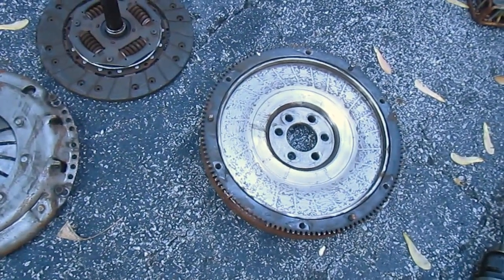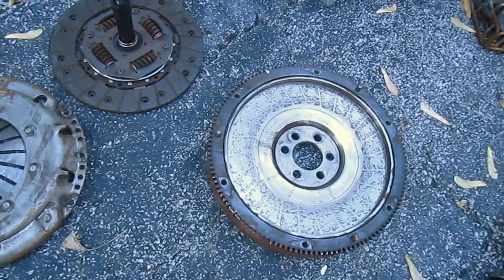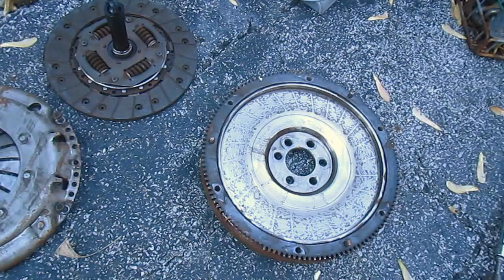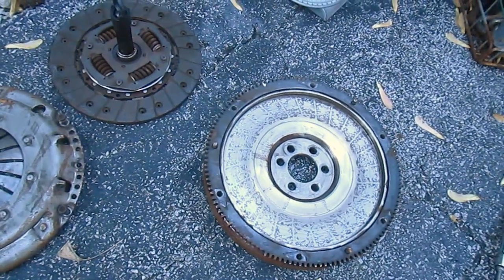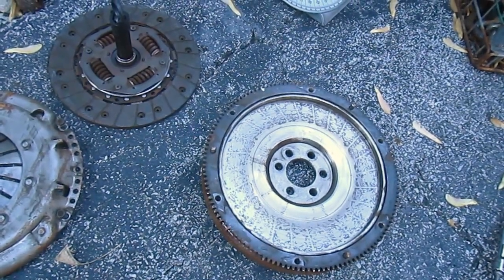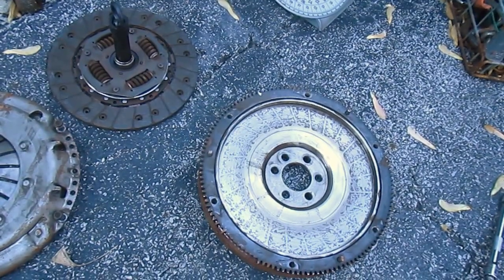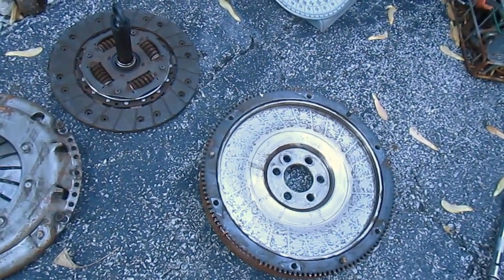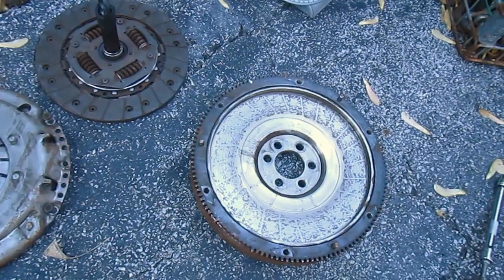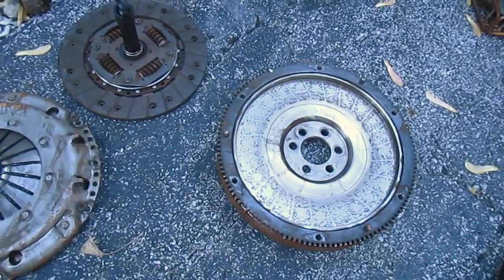That's it — just want to give you guys an update. I'd let you hear the car, but you know how recording devices amplify mechanical sounds and you can't differentiate where it should be versus where it shouldn't be. Basically, when the car is at idle and you press down the clutch, it sounds like a standard TDI running okay. But once you take your foot off the clutch and allow it to engage — even though the car is in neutral — it starts spinning the transmission and you hear a much louder idle, a rattling noise. That's just a fact of life for an ultra-light flywheel.